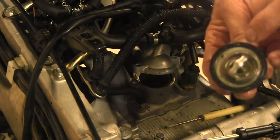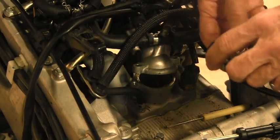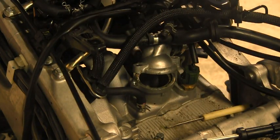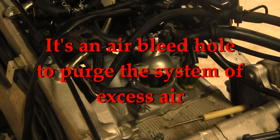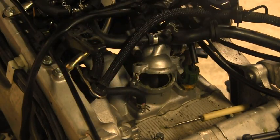There's a little bit — there's a hole; I don't know if you can see it — a hole in the front. It always goes in the front. It's some sort of bypass, I guess. There's always a little bit of water going through until the thermostat opens up. But all the water is drained out of the block, so now I'll go test this thing.